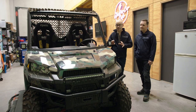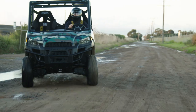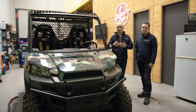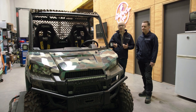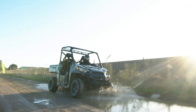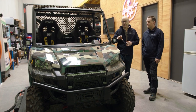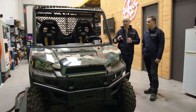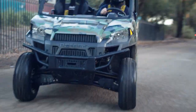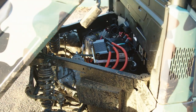So let's start with the drivetrain. First of all, it has three motors — two in the front, one in the rear — which means we've got independent wheel drive, or four-wheel drive. The customer wants the vehicle to have high survivability: if one of the wheels is disabled for whatever reason, the vehicle can still run and drag itself home if the need arises. We've needed to shoehorn three motors into the vehicle and tune them so the motors aren't fighting each other or one doing more work than the other. The packaging has been particularly challenging but rewarding to pull off.